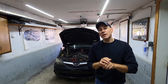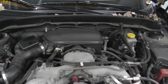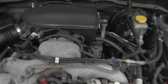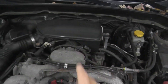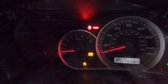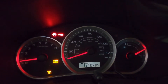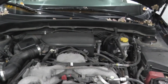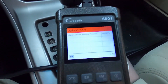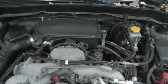This does not necessarily mean the sensor is bad. This MAP sensor is working 100%. Off camera, I disconnected the harness connector from the sensor — first to show you what the dashboard looks like with the check engine light on, but second, with the harness connector disconnected I'm still receiving a trouble code for P0108. So this sensor is in perfect shape, but you may have a wiring issue.